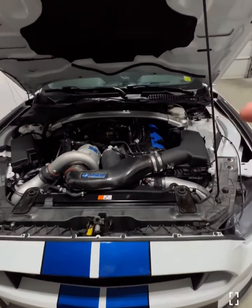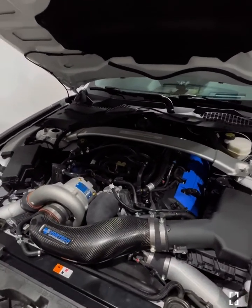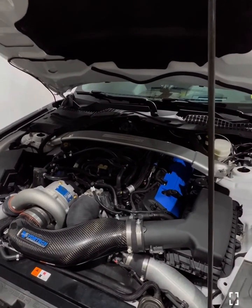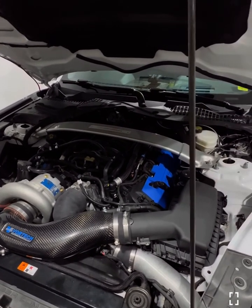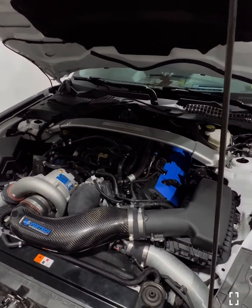We've added 88-pound fuel injectors to the car so we can get more fuel injector pulse width and more fuel. So we're adding air, fuel, and that's certainly adding horsepower. So that's a centrifugal supercharger and air-to-air intercooler for you guys. Have a great one.